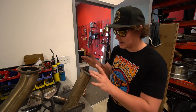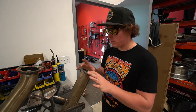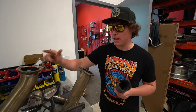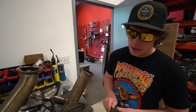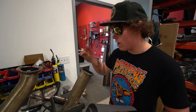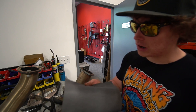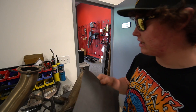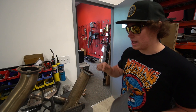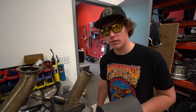The first thing on my list today is getting this exhaust onto the LS2 E36. I was going to put it up but realized we didn't have the gaskets. We only need to make two because the rest are V-bands. I went to Advanced Auto and got this make-your-own gasket material. I just finished scraping one side off — I'm going to lay a strip, cut it, and try to make my own gasket.